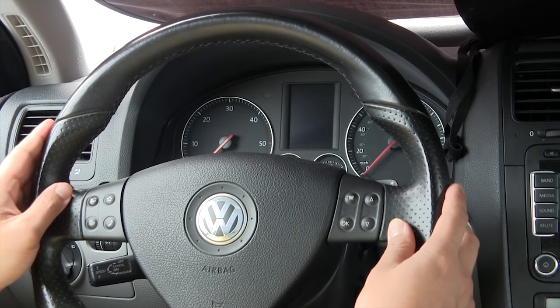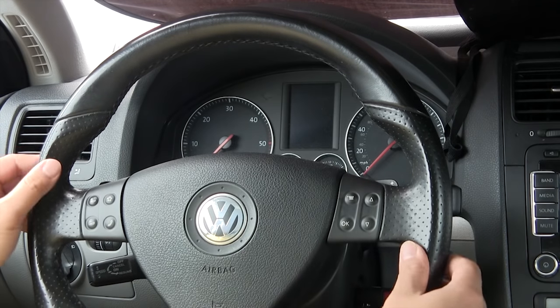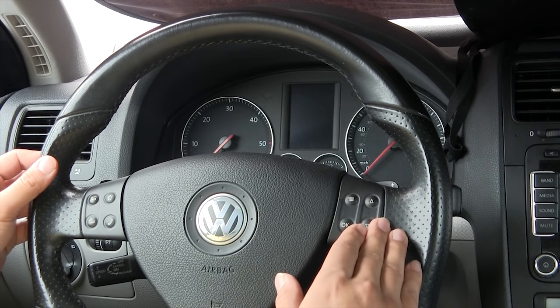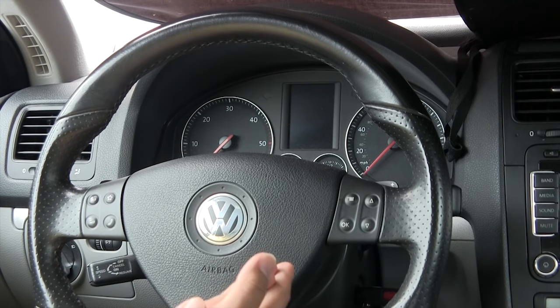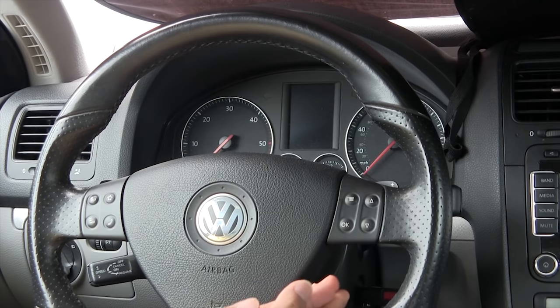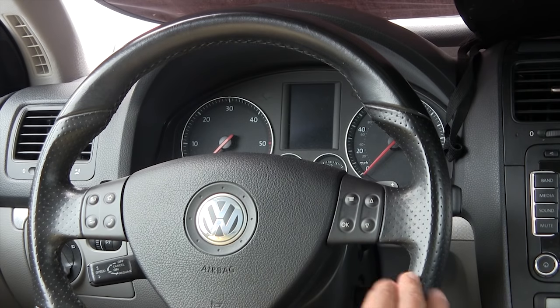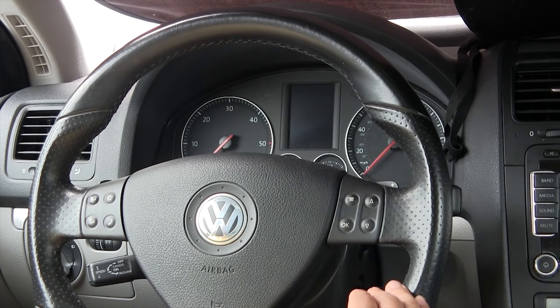Watch out — when you load the tires they'll also increase the noise. To rule out tire noise, drive from new pavement to old pavement, or from a regular road to a bridge, which changes the road surface and the tire-road interface. If the noise changes significantly, it could be cheap tires, old tires, bad alignment, or something else causing tire noise. If the noise does not change or changes only a little, there's a good chance it is in fact a wheel bearing.